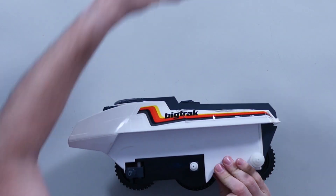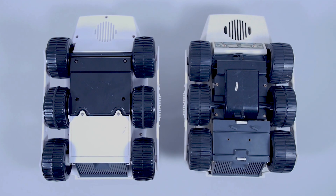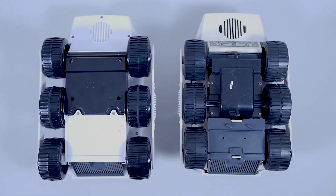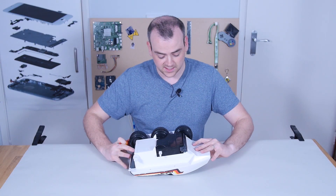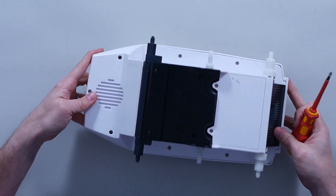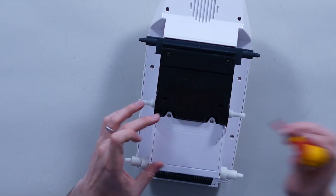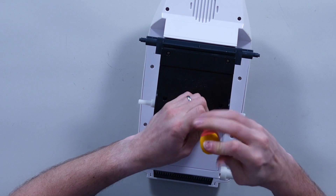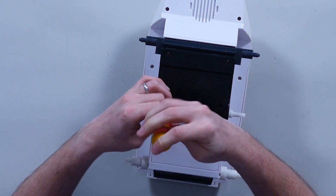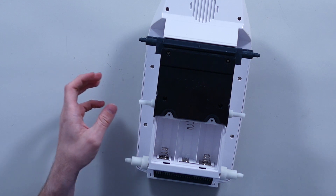With both these models, the driven wheel is the centre wheel — you can see it's attached to a gearbox. That's actually one of the big differences between the two models, and the way I found I could tell the difference was to try and get a photo of the underside. There's a massive gearbox on the 1979 version, whereas this one is very flat. I'm expecting to see a lot of manufacturing differences, and I suspect the 2010 model has been built to a lower price point, with improvements largely aimed at manufacturability and reduced unit cost.